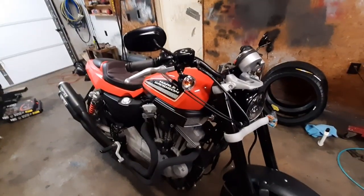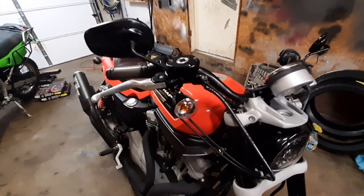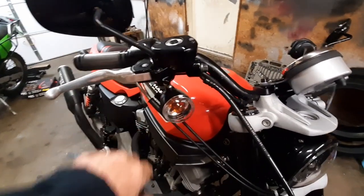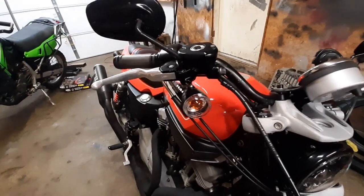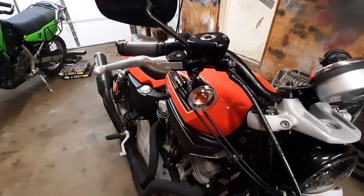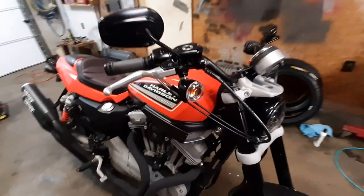Overall I'm happy with it. I would be very happy if they just fit like they're supposed to. The only other complaint I have is the bulbs they sent — these are 1156 and 1157 A bulbs. They cheaped out. I don't even know if there's a price difference, but the A bulbs are an amber coated bulb — they have a coating on the inside that makes it amber. The NA bulbs are natural amber; the glass itself is amber. What happens when these get some age on them is that amber coating on the inside starts flaking off. You can just put new bulbs in and that fixes it, but it would have been nice if they just sent the NA bulbs to start with.